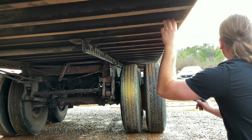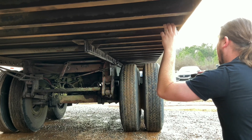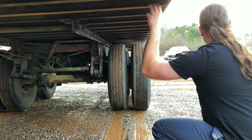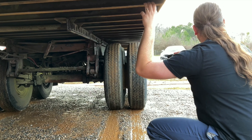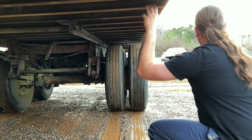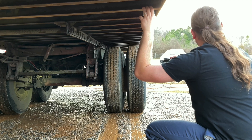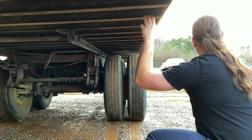This trailer does not have shock absorbers or air bellows. For my brakes, my hoses are not cracked or leaking, my brake chambers are securely mounted and not leaking. My slack adjusters have no broken, loose, or missing parts; my pin and cotter pin are in place and securely attached to the push rod. With my wheels chocked and parking brakes released, I should have no more than an inch of play.